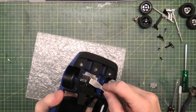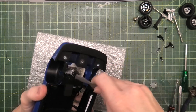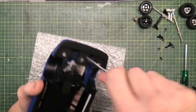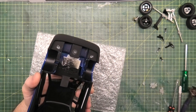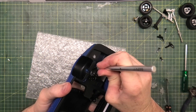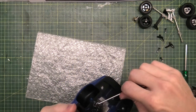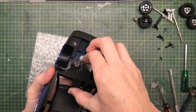And you'll feel when it's actually getting quite loose, you'll feel the part moving around as you're trying to cut the glue out. So definitely you get a feel for it the more of these models you pull apart. So just keep cutting, slicing and prying to try and remove all of that glue, because it does run down into the little edges. Just going to cut this a little bit deeper. Just pry a little bit more residue out. And there we go, I can feel it move already. So there it is, that is the hot glue removed that was holding the dashboard in.